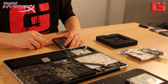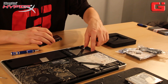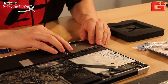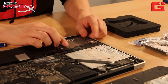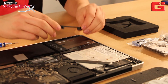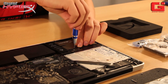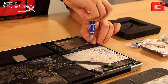Second screw — again, don't screw it in completely. Then take the SSD, plug in the data cable, and push it into the MacBook. If it doesn't fit in, please unscrew the screws and check how far you need to screw them in. Then take again the piece of plastic, place it down onto the holes, and screw both sides in. You don't have to use a lot of pressure — do it slowly, take your time, and everything will go well.